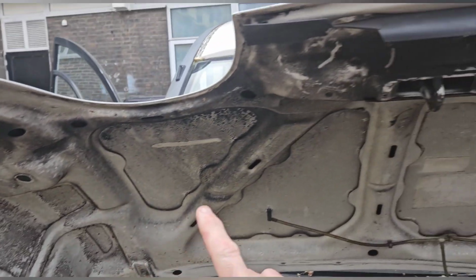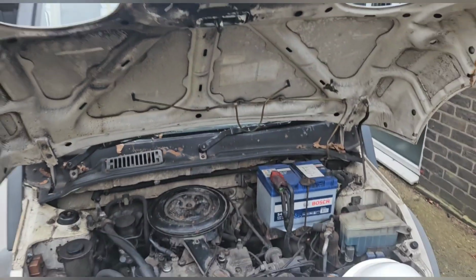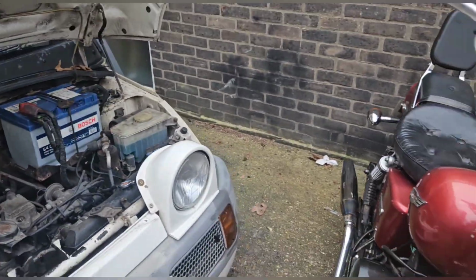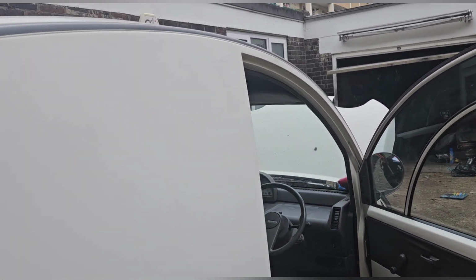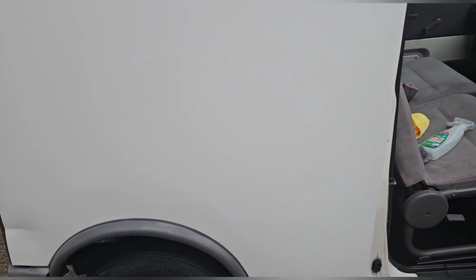Look at this now. This is where I'm going to start hacking away at first. Trying to do something with that. It sounds lovely. Just hacking away, guys. Looks a bit better in places, but of course, when you're polishing a bike, it's so quick and easy, really. When you go to a car, look, I've done this panel. I've cleaned it, and I've used ultimate compound on it. Next, I think it needs a super resin, and then a wax will be the way forward. But my hand hurts. It's work when you're doing a big vehicle, and you can't see. Oh yeah, there you go. You can see a bit of progress. A bit of a resin layer will really help that pop.